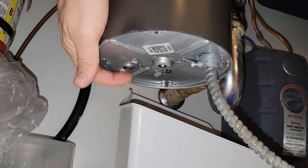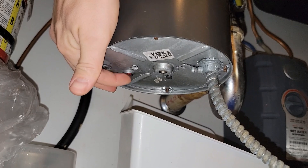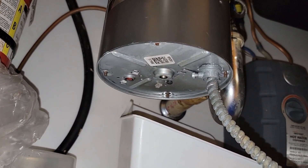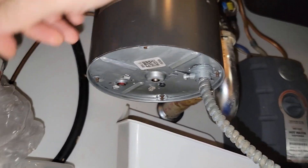Another thing to mention: when they get jammed they'll also overheat. There's a little red button here — see how I just clicked it up? That means this thing was overheated and the overload protected it so it won't catch fire. Every time you free it, you'll need to push that button and then try your power switch again.